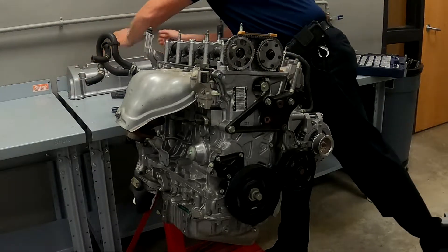We can let that dangle while we put the chain guide on the front side of the engine. Then you would clean up your timing cover, apply your RTV, and set everything back into place. We also have to slide the tensioner guide back in. Remember the two shouldered bolts for centering. Now our timing cover is back on, bolts are back in place and torqued.